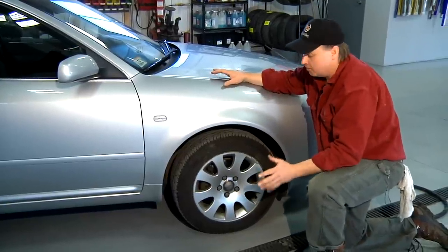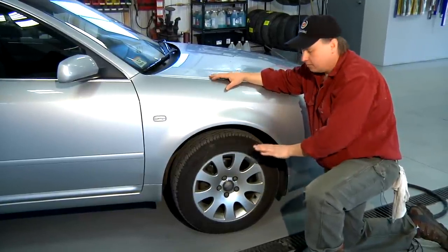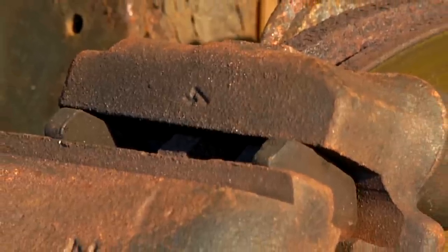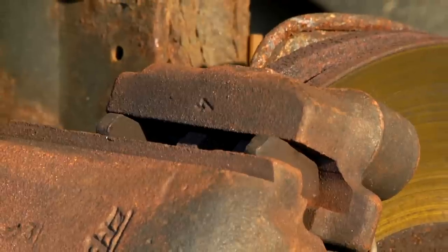After I do this, I'm going to be very careful to test my brakes. When the brakes are wet, the stopping power is diminished considerably. I'm also going to want to be sure not to wash these brakes when the temperature is below 32 degrees, as the water will freeze on the brakes and the brakes won't function at all.